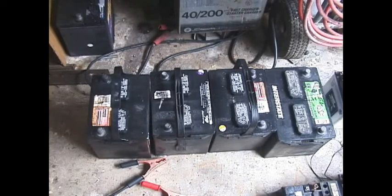These batteries started out life at like 3 or 4 volts, and anywhere from no hydrometer reading to low in the red. They have all been restored to batteries that will crank a car — using equalization, and sometimes Epsom salt, and sometimes aluminum sulfate. So it is not impossible to take a battery that has a hard sulfation on it and have it come back to life.